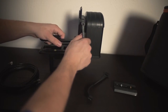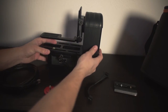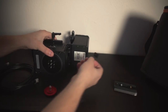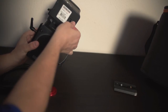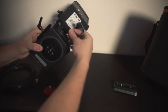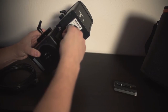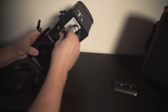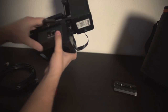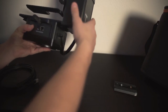Make sure that's locked back down. Now it's time to attach the data cable that connects the pan motor to the tilt motor. Flip it over on its side and plug one end directly into here, and the other end directly into here. I had it upside down. So those two go together and you have this little cord just hanging there. That's okay — just make sure you don't pull on it or anything like that.